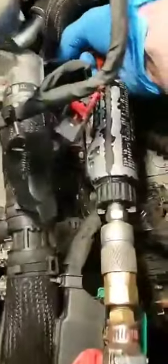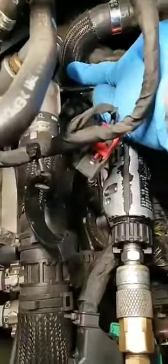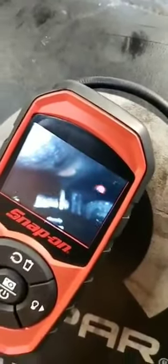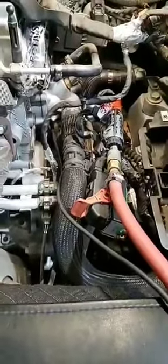Here's the last 10mm — put your extension with a swivel 10mm and use the extension to guide where the 10mm is at. Push the extension through this line hole into it, and that's most likely where the 10mm will be from the bottom. I put the camera in there so you can see where that 10mm is — I usually just get the feel for it. Let me take the camera out and I'll show you how I slide that thermostat out.